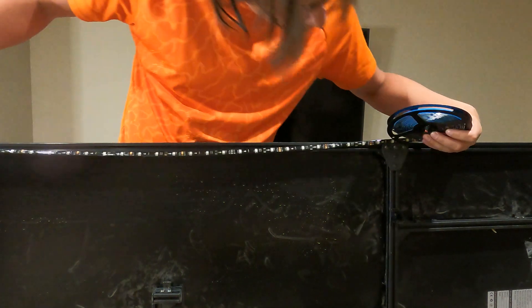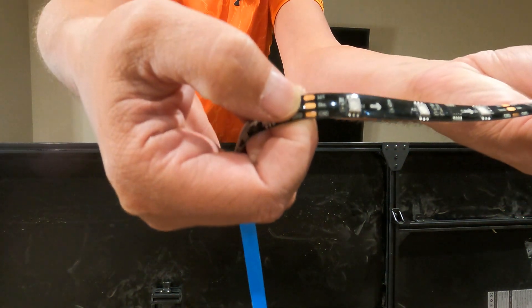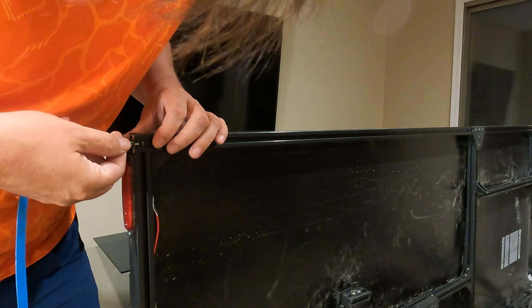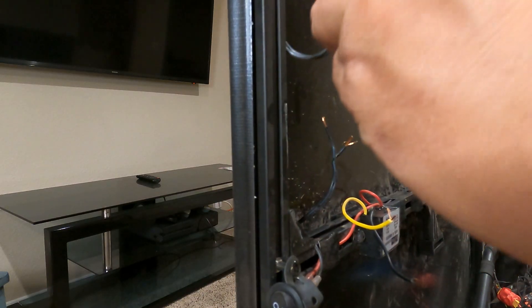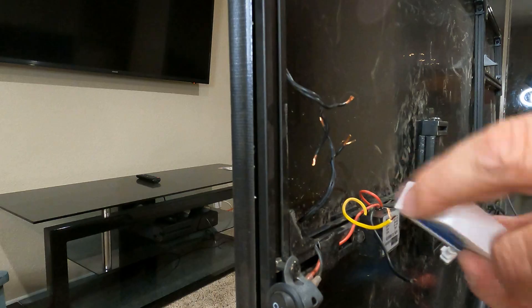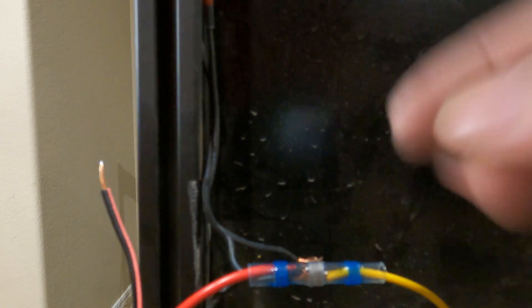The nice thing about the LED strips is that at each one of these cut points they can be cut in half and new wire soldered on. I cut up the wires for my rear lights because this is where I'm going to adapt in the little inverter. I'm going to wire a bullet connector into the connection on the other side of the switch so that if the switch is off it shuts everything else off with it, just to save power so there's no Bluetooth or anything running back there. These little heat-shrink soldering tube connectors just make life a lot easier.